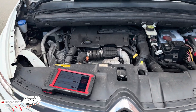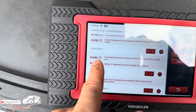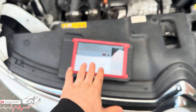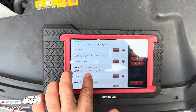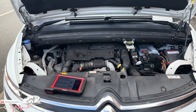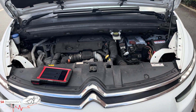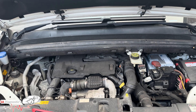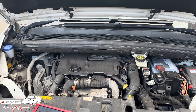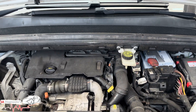Hello and welcome back to another video. In this video I'm going to go through fault code P1694 — control engine start and stop fault on the starting motor control line. If you're getting this fault and a warning on the dashboard saying start/stop malfunction, the symptom is usually that at traffic lights the car doesn't restart after it turns itself off.